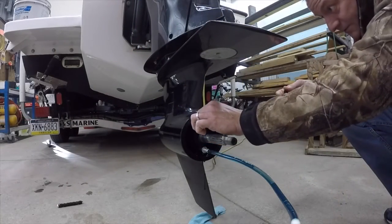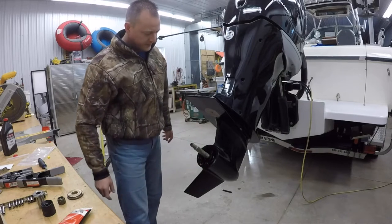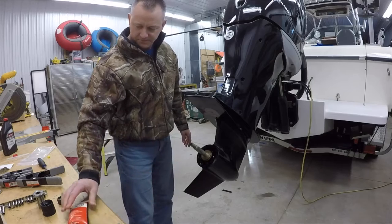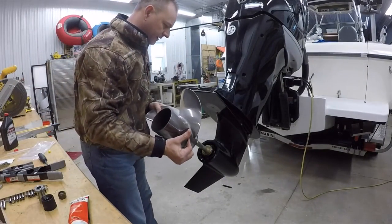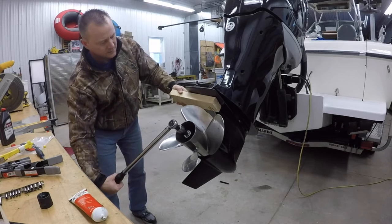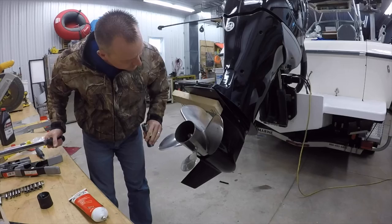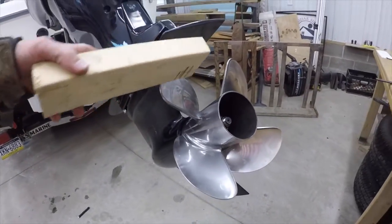We've got oil flowing out the top — let's put the screw in there. We've got the drain plug and the fill plug for the lower unit, once secured and tightened down, with new seals on those. Now we've cleaned up the thrust bushing here. I've got a good amount of grease that I'm using — let's get the prop and gently put that on. Now we're going to want to bend the tabs up to lock that nut on the shaft, and then this job is done.